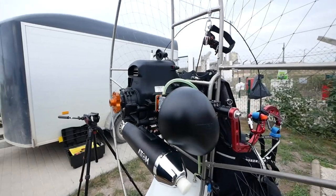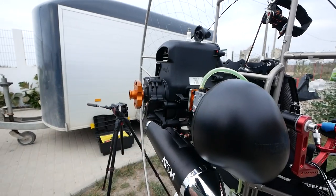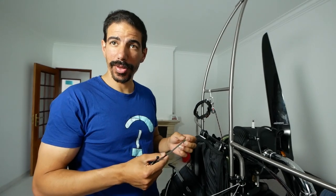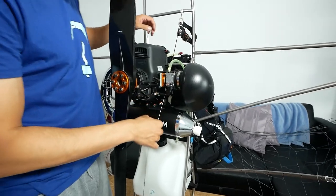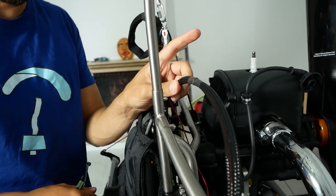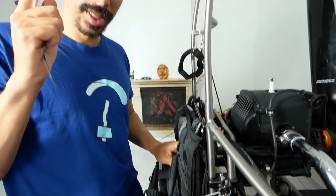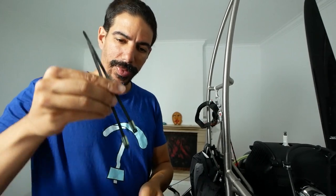At least that's one step forward. We just need to get the bolts to the propeller, the tacho installed, and the throttle installed. It's really difficult to film and do something you're doing for the first time, because with all this stuff there's a lot of experimenting for your particular motor. On the Atom, the throttle cable goes to one side and the kill switch goes to the other side of the motor. If you want a really good tutorial on how to install the off-grid throttle, check out the Aviator video link — Neil did a really good job and I learned about standoffs from him.